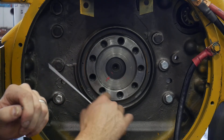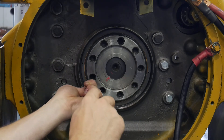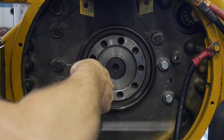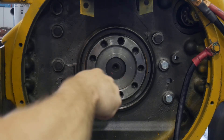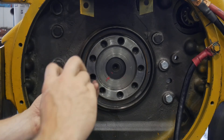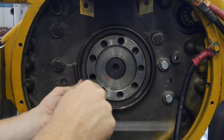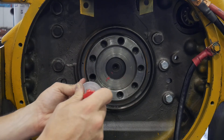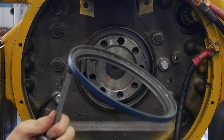I did this one a little tight to the edge — take some of the shavings off of there. Screw the screw into the seal until the adapter sticks out, then mount our slide hammer onto it. We would normally do this on both sides, and then we can simply use the small slide hammer to work the rear seal out. And now we've taken the rear seal off.